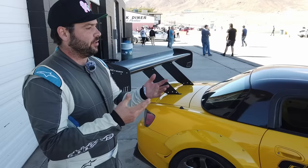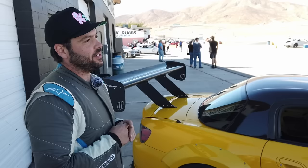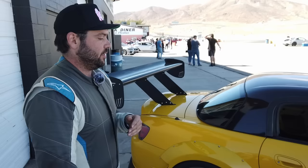Yeah, 520 is where it's at right now, and we're pretty conservative on that, but obviously with the older G35 or GT35 turbo, it's going to give a little more lag the more boost you push at it. I actually don't know how much faster it is at the smaller tracks like Streets of Willow, where you hit the gas and it just goes, for sure. Even the same turbo, the GTX3582, we use that, and AMS uses that in the Supra as a drag kit.